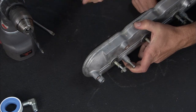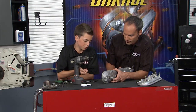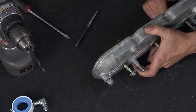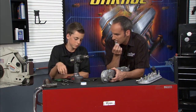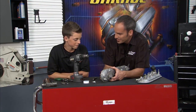We're going to fold that down, seal it off, then drill a hole right there. We hit it with a center punch, use a pilot drill bit so the next size goes in straight, then tap it so it's threaded for the fitting bolt. We take this fitting, stick it right in that tapped hole, and put Teflon tape on it before installing. Ready to make some chips!